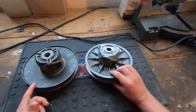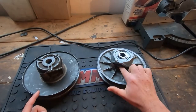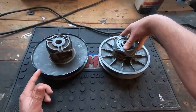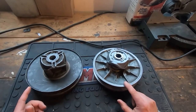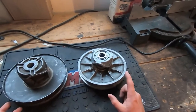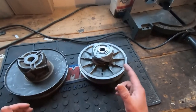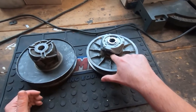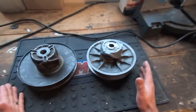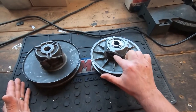These newer clutches were used from 1988 up to at least 2014, with the only difference being in 1997 they changed the spring — and anybody can swap the spring. It's difficult to find the '88 to '96 versions of this clutch. You'll see them on eBay sometimes, but usually they're old and guys want a fortune for them. Just know you can buy a '97 and up clutch — it's the same exact clutch — just make sure you're using the right directional spring. If you're putting in the torque spring from Cart Parts Plus, you can get that plus a '97 and up clutch and it'll work in anything, because the torque spring is not directional.